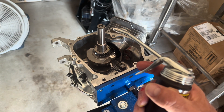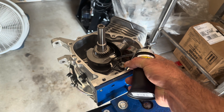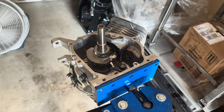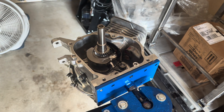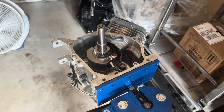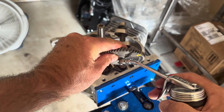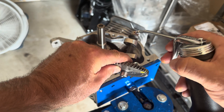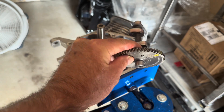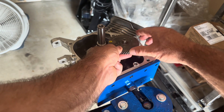For the rest of the assembly I just use engine oil. Make sure to squirt some down on the crank bearing before we button this up — there's already some on the rod from when I assembled it, but we'll put a little dab on there. We also want some down in the camshaft bearing. We'll take the camshaft and put a little lube here, a little there, a little on the lobes, and get ready to install it.